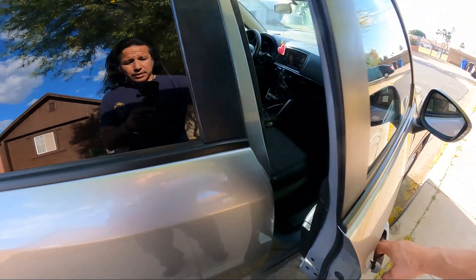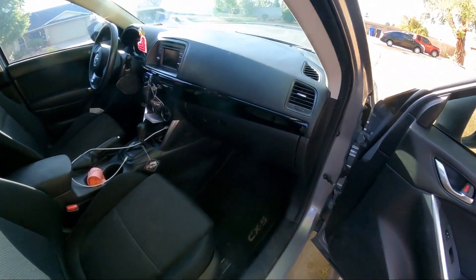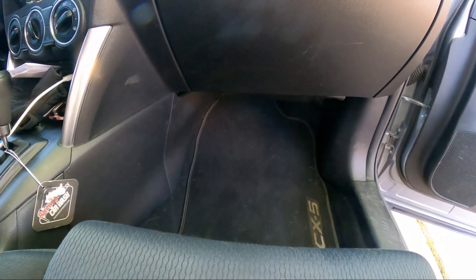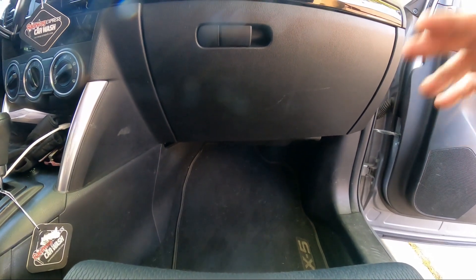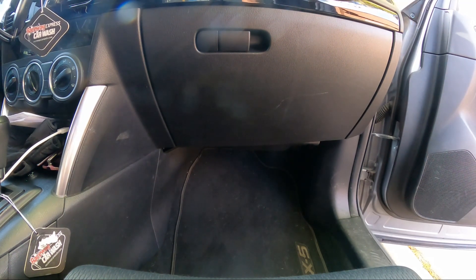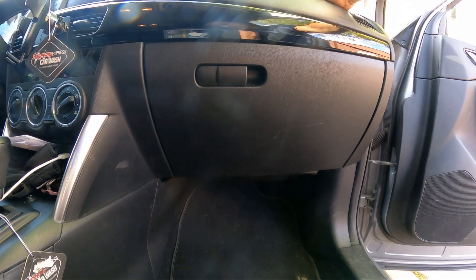The customer complained that the air is not as strong as it used to be and it takes a little longer to cool down. Always one of the first things I like to do is inspect the cabin filter if your vehicle has one. Always cover the basics first — this vehicle has a hundred thousand miles and I don't know if the cabin filter has ever been replaced, but today we want to find that out together.